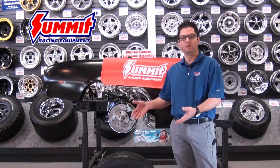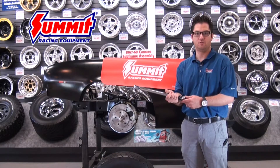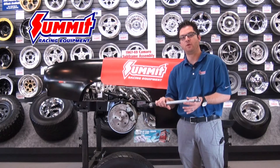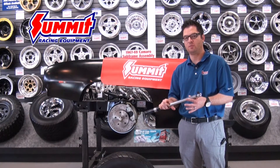There's a few things you're going to need to mount the new wheels and tires properly. The main thing you're going to want to have on hand is a torque wrench, so that you can properly torque the wheels down. If you do not properly torque your wheels down, you can end up warping your rotors if you over-tighten them or if you do not tighten the wheels in the proper sequence.